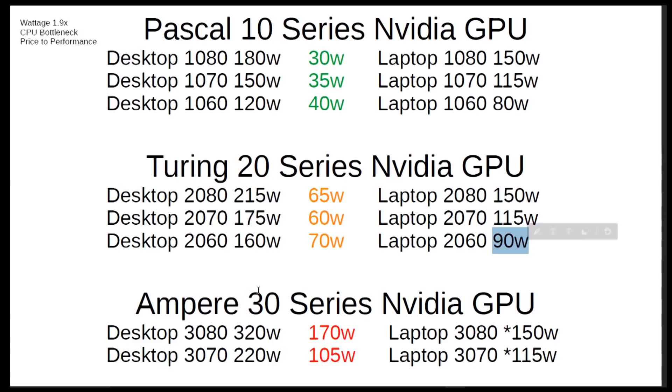Now, when it comes to what we're looking at today, the Ampere 30 series: the 3080 at 320 watts — if you're a desktop user, the performance is spectacular. But you're going to have to remove more than half the wattage — 170 watts — to get into the 150-watt envelope needed for some of these 7 to 10 pound muscle books. And if you want Max-Q at 90 watts, you're lopping off down to almost a third of the wattage compared to the 320-watt variant. Expect 3080 Max-Q performance to be half of the desktop variant in gaming benchmarks. The 3070 at 220 watts means ripping off 105 watts to get down to 115 watts inside our laptops — a big kick in the teeth.